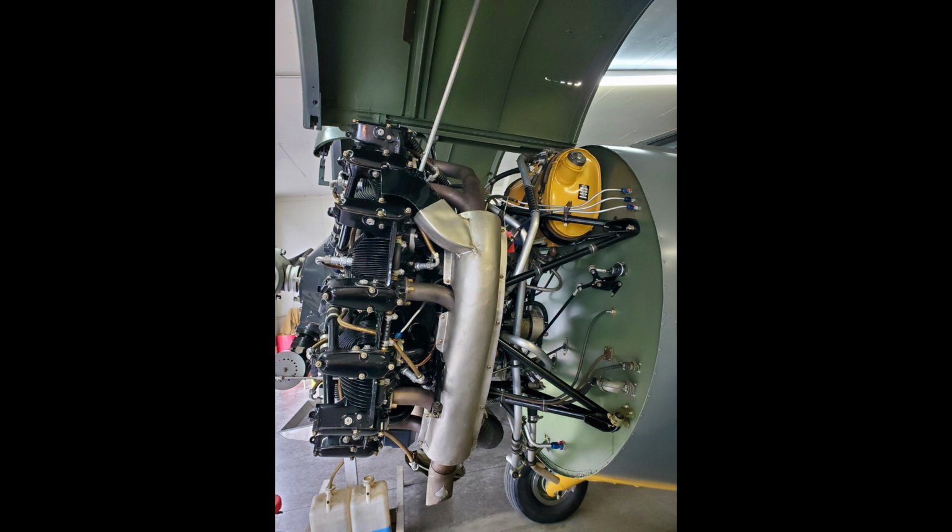And you can see on this, the cowling setup, that takes about 20 seconds to open the side cowling on a V77. It's 6 quarter turn fasteners. The whole side props up and you stick it up with the cowl support rod. You got tremendous access for maintenance and inspection.